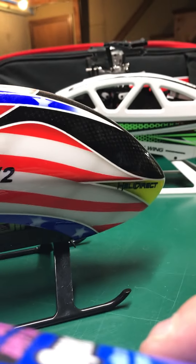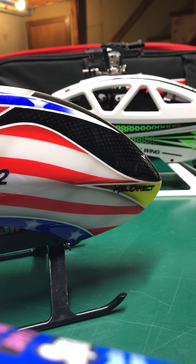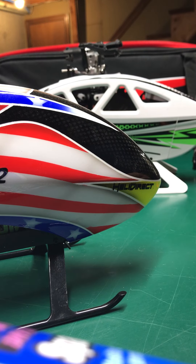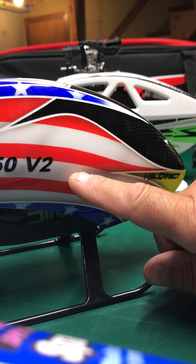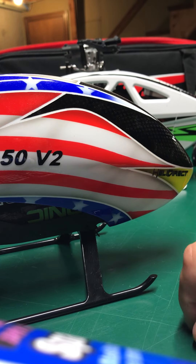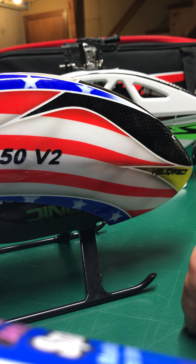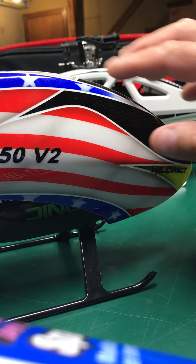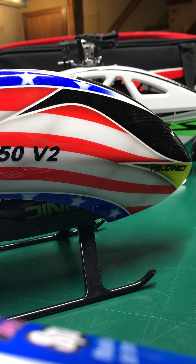It's kind of a cool idea — you just need the two parts. I think it cost about seven bucks but it's the shipping that'll kill you. The ESC install plate — I had to get it for the V3 that crashed — was about four bucks, and the battery tray was three bucks. It's a good modification to the V2. This is Cruiseroy on the FW 450 V2.5 with a modification: drill a couple of holes, take some velcro off, remove the ESC plate and replace it, and you've got a fast battery clip change plan instead of velcroing it. Maybe it's for some people, maybe it's not, but I thought it was a cool idea. I'm out of here.